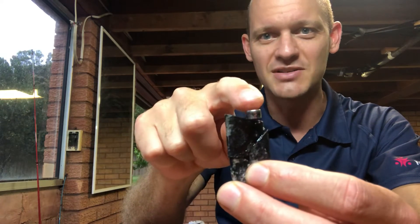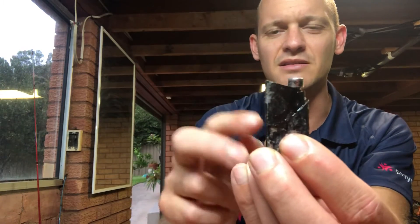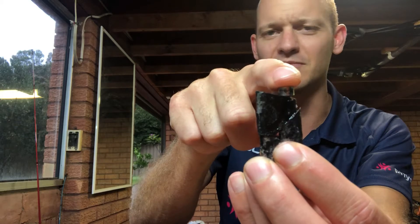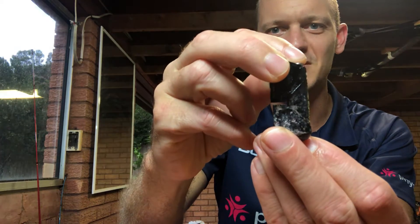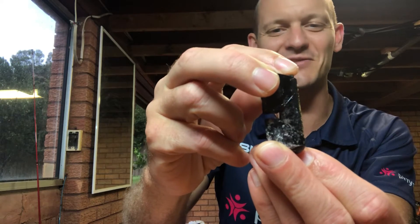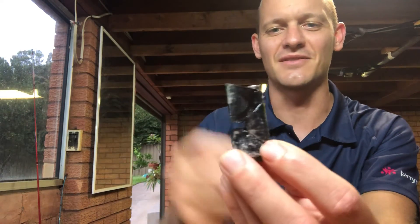What you need to do is don't take the bolt out all the way — leave it in a little bit. Then, while it's still in the bike, give it a tap with a hammer. Don't go crazy with it. What you want is for the wedge to release, just like that. Give it a tap — bang! It didn't come out that easily at first, but I gave it a knock and it loosened up.